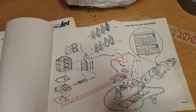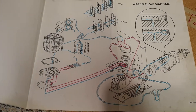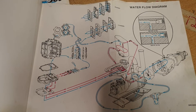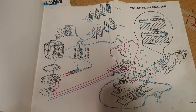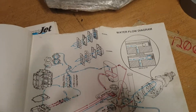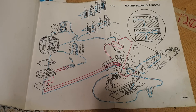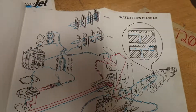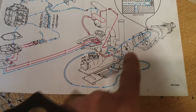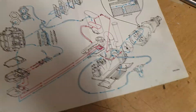Let it cool down a little, then head back to the dock slowly. The best approach: leave the boat on the trailer strapped down, back it into the water with the drain plugs in, start it up right there, and let it idle. You can rev it up a little and see if the engine starts overheating — give it about five minutes. If it isn't overheating there, you can take it out on the lake and give it a try. This particular engine tends to overheat at lower idle, which is a cooling system issue produced from the jet pump and making sure all lines are cleared out.